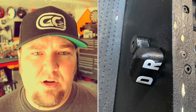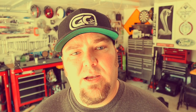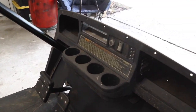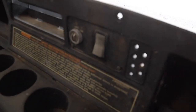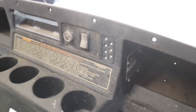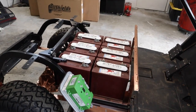If you have a series cart, you're going to have a lever under your legs and there's not going to be a run-tow switch — that's the easiest way to identify it. For a Drive Control System DCS, you'll still have the lever under your legs but with a run-tow switch. For a PDS, it's going to have a rocker switch on the dash — sometimes between your legs, but most of the time on the dash — and you'll have a run-tow switch. Those are the three easiest ways to tell what kind of cart you have.